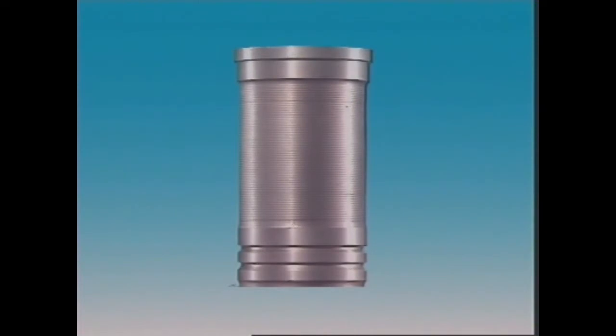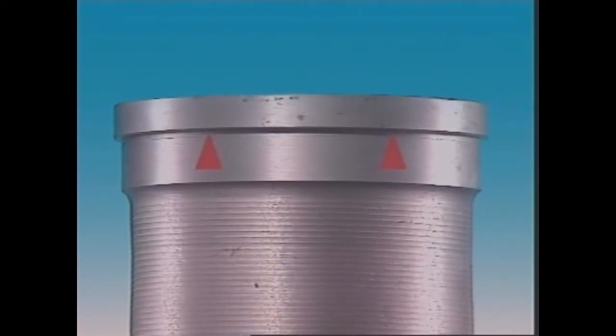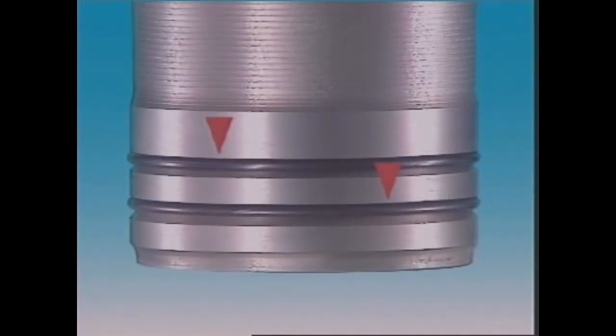The sleeve is sealed at the top to prevent coolant leaks. This stops coolant entering the combustion chamber and the bottom of the crankcase. A flange at the top of the sleeve fits into a recess in the block. The lower end has 1 or 2 neoprene sealing rings. With coolant in direct contact with the cylinder sleeve, corrosion can be a problem. It can even insulate the sleeve from the coolant, which reduces the main advantage of having a wet sleeve at all.